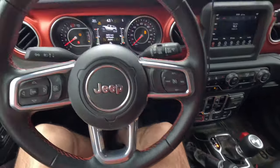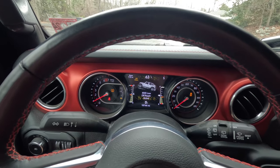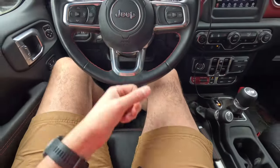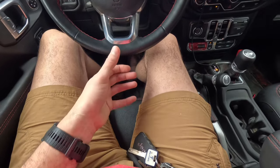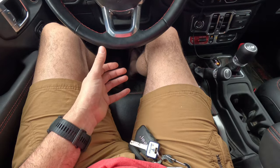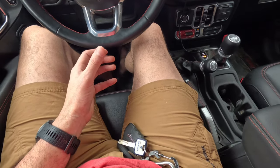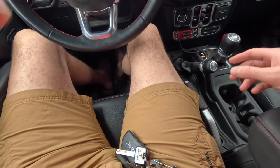Four-wheel Off-Road Plus also functions in low range. When you hit Off-Road Plus, you'll see 'four low Off-Road Plus active.' What that's going to do is allow the Jeep to really crawl — the computer changes the way the transmission shifts so it won't shift as fast. You'll be able to hold gear and hold power much longer than you would otherwise.